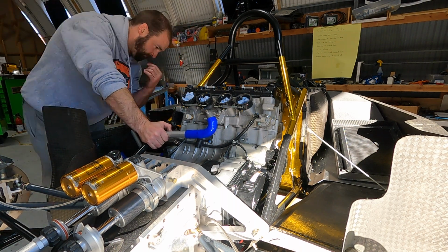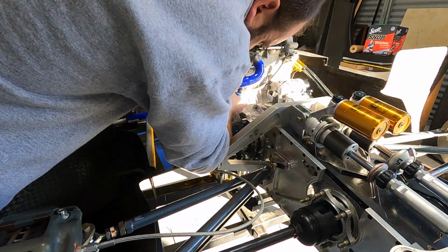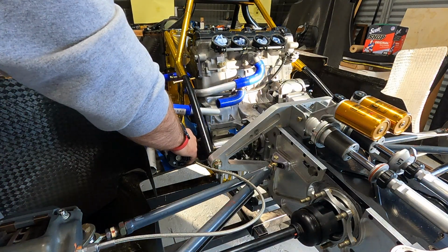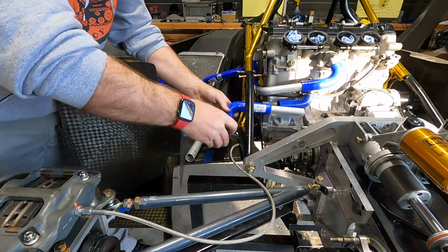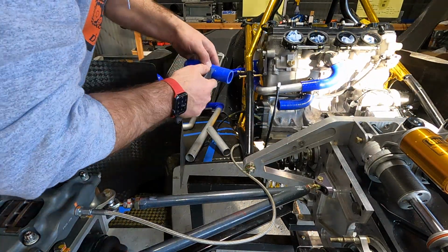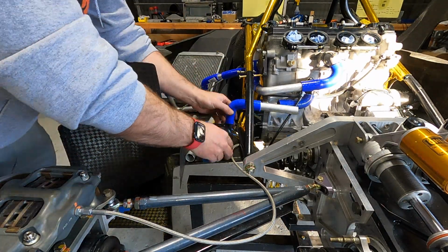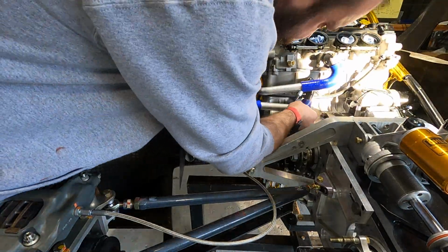Not only that, we've got to lay the groundwork, or at least get a roadmap for what we need in terms of the swirl pot. Now, some people know, some people don't, but the swirl pot is basically the high point for a cooling system. If we didn't put this in, we wouldn't be able to really have the radiator cap at the highest point in the system.